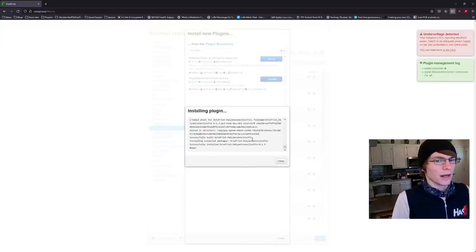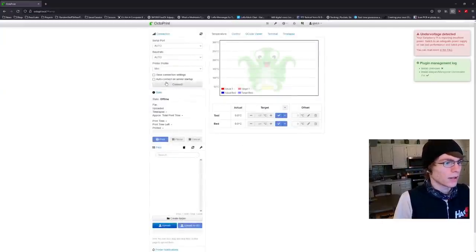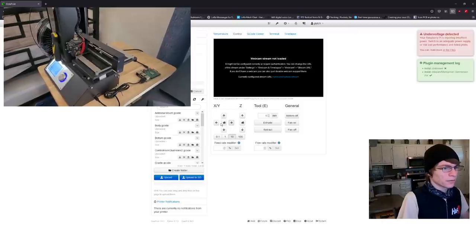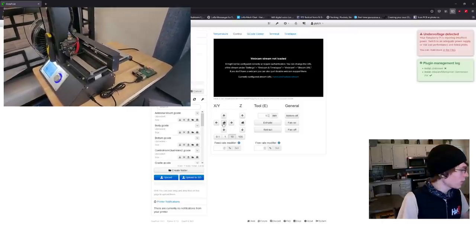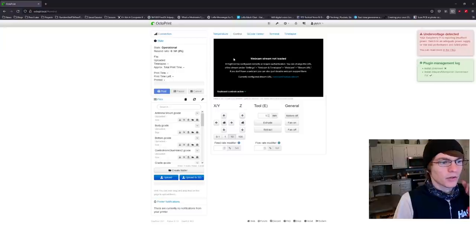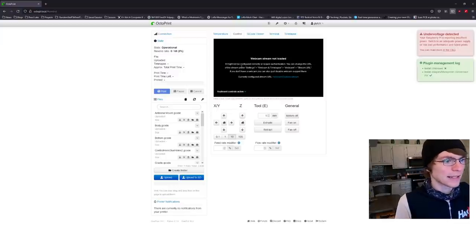Now it seems to be working. You can get some little hitches and issues when trying to connect to the printer in the main menu. But now that I've installed that plugin, I can go to serial port, set the baud rate, and hit Connect. If I go over to Control, we can actually make it move — hit the Home button and it'll do the homing routine. Here's another thing we'll cover in this series: the webcam. You can view your printer, start prints, and do everything from anywhere in the world to make sure it's running safely. OctoPrint does note that 3D printers are inherently dangerous machines because they get hot, so you probably don't want to leave one completely unattended — but you can.